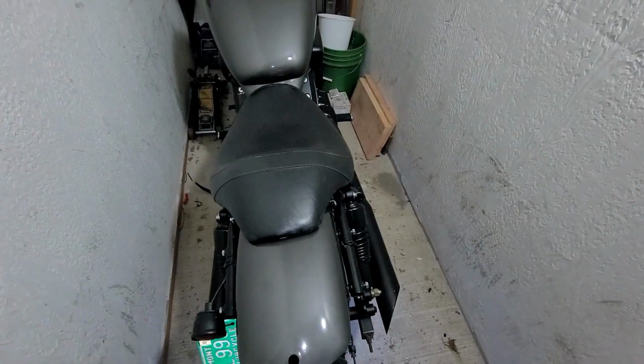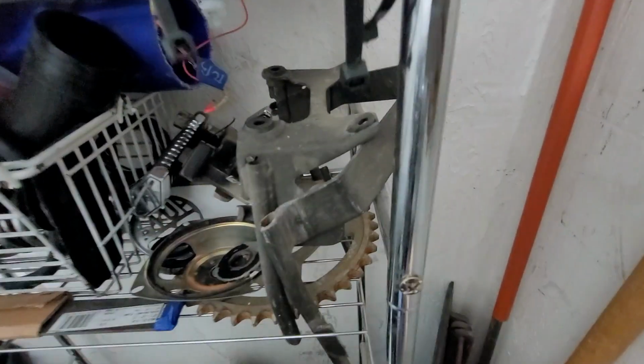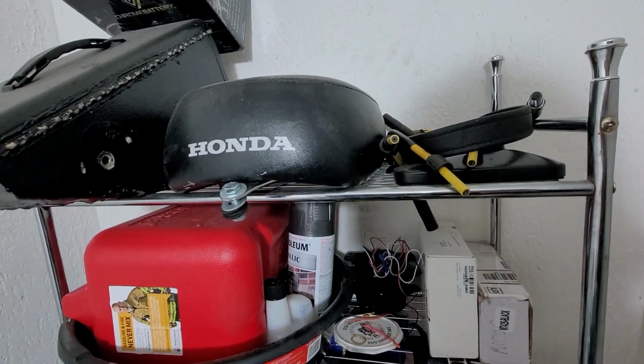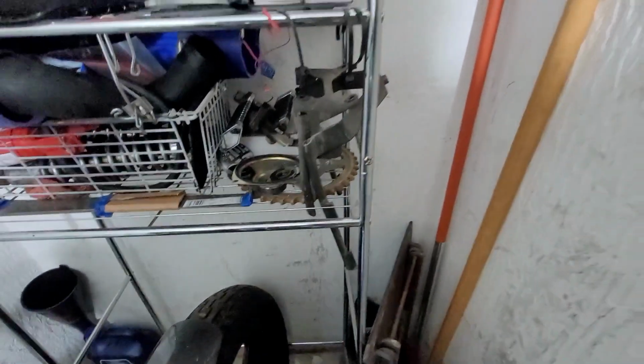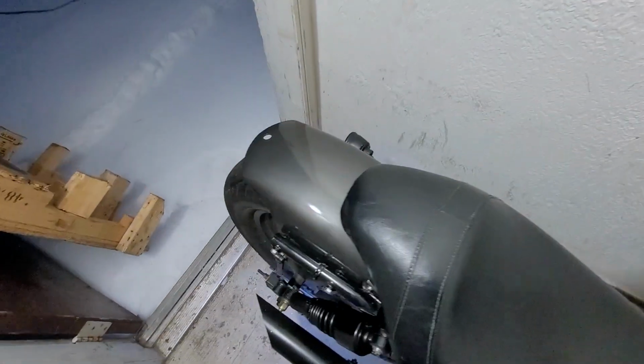Now, the way that was done was originally, if you take yours apart, you'll see this on the third gens. I don't know about the second gens. I think that they have metal fenders, but this is how much I trimmed off. Both of these pieces, that's the license plate bracket, and that domed triangular thing right there is what used to be underneath that hole to hold the back of that seat up. But I've discovered that seat actually sits perfectly on top of what is left underneath there anyways. So this is not necessary. I chopped it all off, and I chopped it off at the nubs there instead of at the pipe. It's very easy to chop off with just a handsaw. I think it's aluminum or something. It's not very strong. It doesn't need to be. It just needs to be stamped like an airplane.